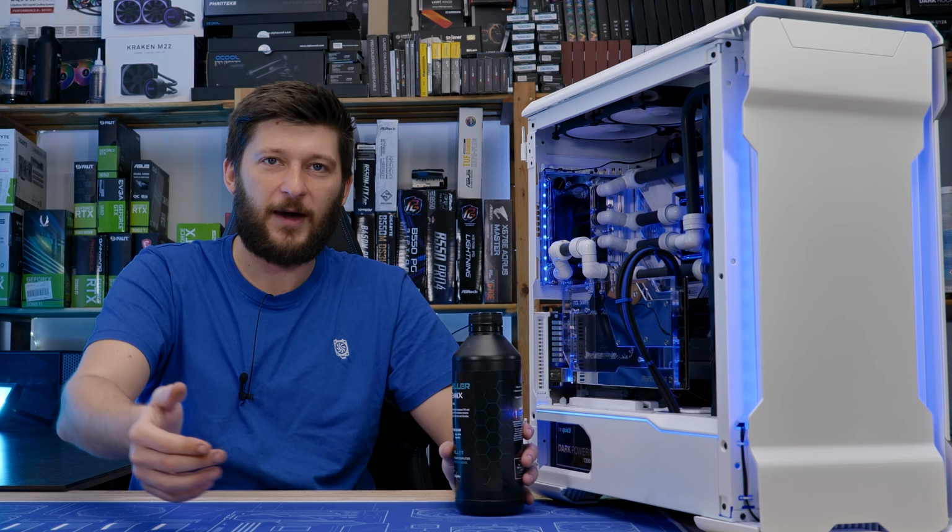And we also tested the GPU alone, doing Furmark 4K 8X MSAA. The original 3090 Ti with that tough cooler was hitting about 68 degrees C, and it had a hotspot of 82.2 and somewhat degrees C. Now with this setup, the GPU is sitting at 56 degrees C, so already 12 degrees below, and the hotspot is sitting at 79. So very, very good temperatures.